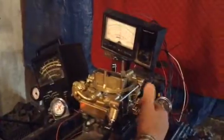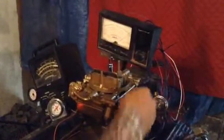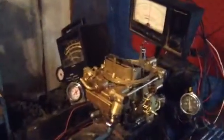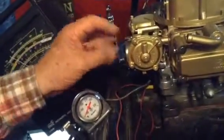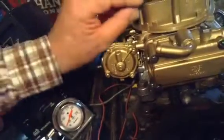This has got the kickdown for the automatic transmission for the Ford. And it's got an electric choke — when it gets cold weather, 45 degrees, you loosen those three screws and turn that until that choke shuts off and touches. Tighten the three screws back up and hook your wire on there, and when you turn the key on it'll turn that choke off. You don't need to move it — it's probably good for six months.